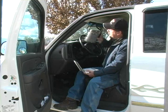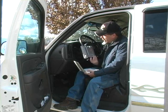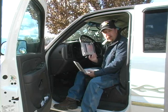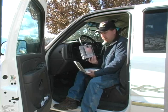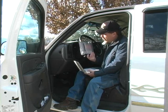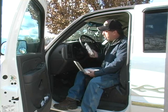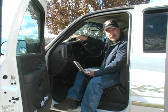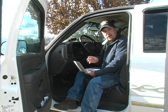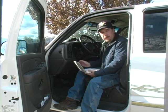The other option was to pull your ECM out — this is out of a 2008 LMM, located right underneath the driver side battery, pretty simple to pull out but a little bit of a pain on the older trucks. You pull it out, box it up, ship it to us, and we plug into it with a benchtop wiring harness, use our laptop to program it, box it back up, and ship it back to you. The only problem is your truck is down a few days.